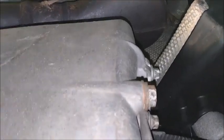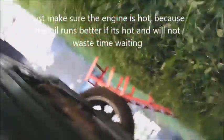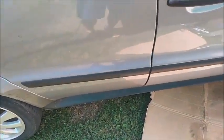Yeah, so this is the drain plug in the middle. It's a 13mm socket. I'm going to put the drain pan and open it slowly, careful of the hot oil, and it's better to use gloves. Of course, we'll make sure that the car is secured on the ramps and the anti-roll block. And just in case, if you want to put a tire beneath the car, you will see in my other videos how to jack up this car.